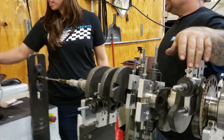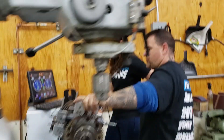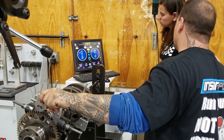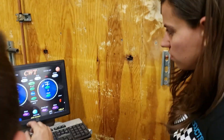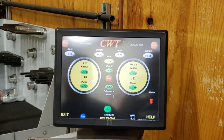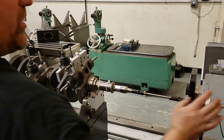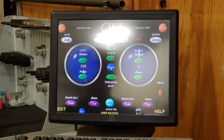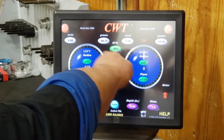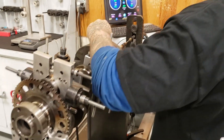That's quite a bit. First thing you're going to do is work on the side that's heaviest. As I move this around it tells me the angles. At zero is where it wants you to remove or add weight. We are on remove right here. Our right stanchion is heavier — 63.56 versus 34.77. We want to be opposite on the two dials. We're going to bring it to zero — that is our location. Right here it wants me to remove weight.